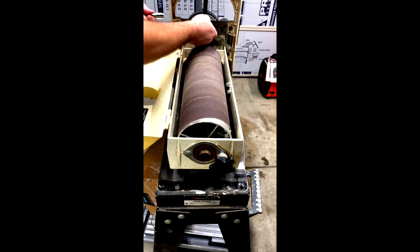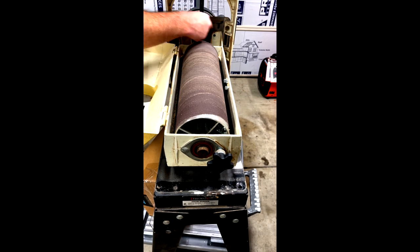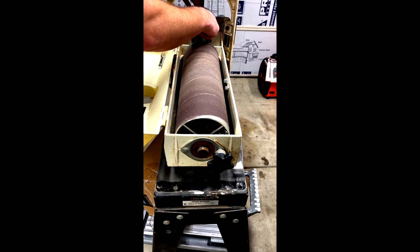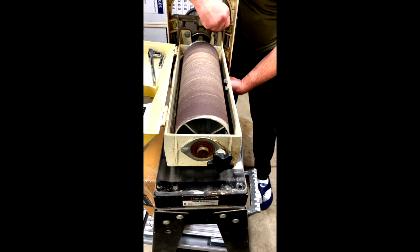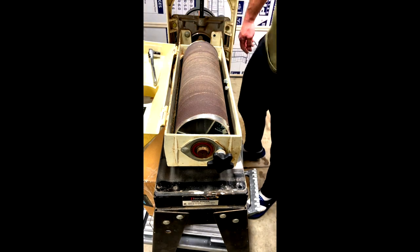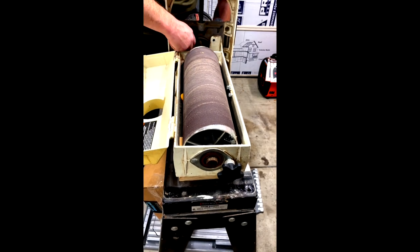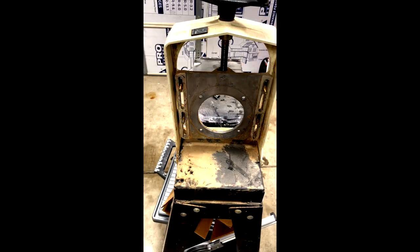Between the drum and the motor there's a coupling — it's a couple of Allen keys to get that off, and then the two can absolutely separate. Right about here you should be putting some blocks underneath the drum, and if you had a second set of hands for the motor that would help out. When you release the bolts and the couplings, the furthest ends start to sag.